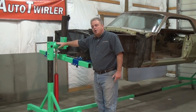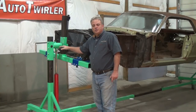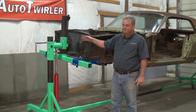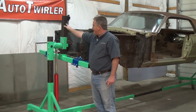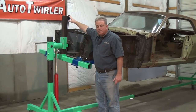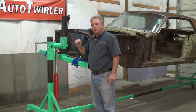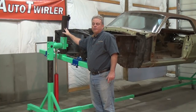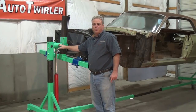One unique feature about the Auto Twirler Pro is the fact that it's got ball bearings inside the pivot. It takes a lot of the drag off the pivot and makes it easier to rotate, but an o-ring right here at the end seals up that entire cavity. So if you do want to sandblast on it, you can do that without contaminating those bearings. The second feature is the balancing system — it is infinite. You can move it along this path anywhere you want simply by putting a ratchet here on this nut on top of the swing arm and moving this acme-threaded rod, which is a wide thread made for lifting. Move it anywhere you want, and wherever you stop turning it is where it stays. You can change the weight distribution of the car vertically anywhere along that path and change the balance point to make it easier to rotate.